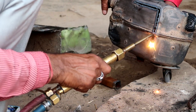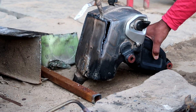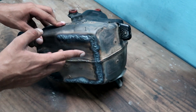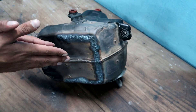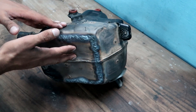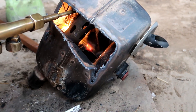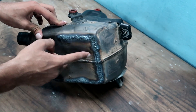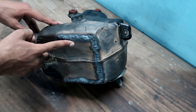Make sure you remove all the collars before taking this exhaust to a gas welder to repair it. Those who want to repair this exhaust have to cut it first, then bend the panel. In the middle there was a metal sheet that was cut, causing the sound. They make a new plate and then weld it, weld the cover, and align it. And that's it.